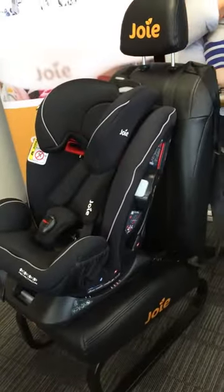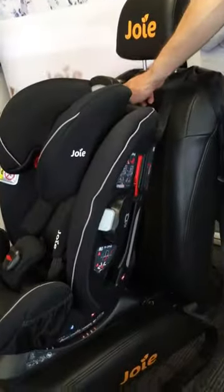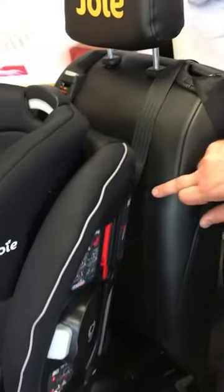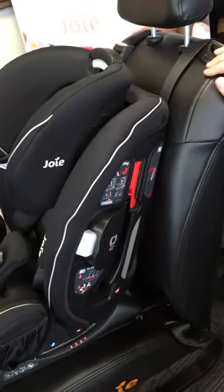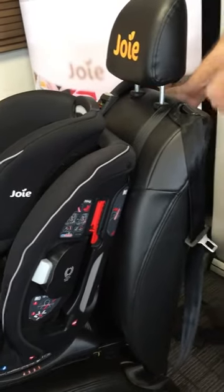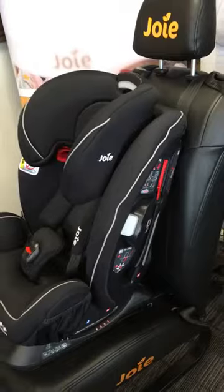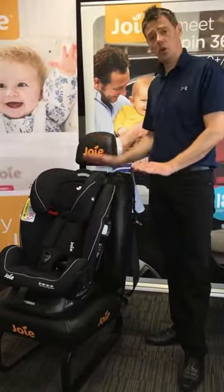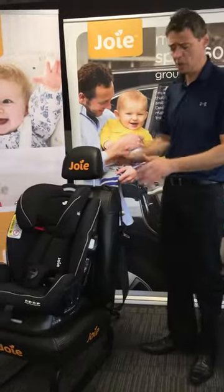Once that's in, it's ready to go. If adjusting through the different recline positions, you may find it adjusts the tension on the top tether strap, so in some cars you'll need to readjust the recline position of the ISOFIX as well. If the seat has lost contact with the back of the vehicle seat, operate the button to slide the seat back to regain contact at the top. Equalise the pressure again by pulling the slack through before tightening the top tether to gain the green indicator. Once you know the routine and principles, the harness remains the same as we've seen for forward-facing — belted or ISOFIX and top tether, from 9 to 18 kilos, approximately a year through to four years.